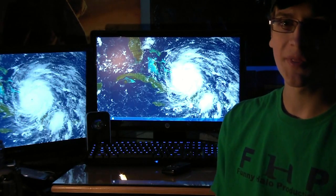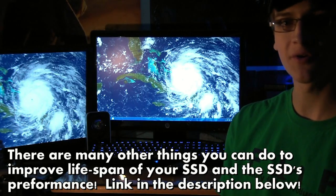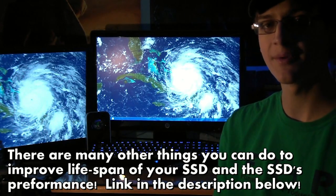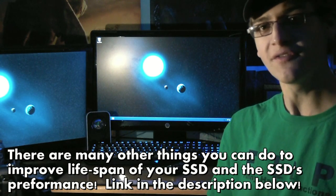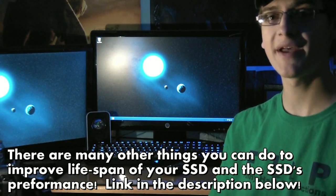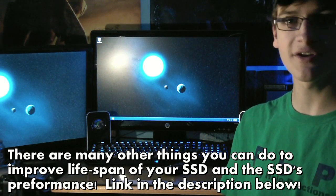The question becomes: is it worth it? If you ever change your mind, you can always boot from your old hard drive again, as long as you don't delete the OS — just go back into the BIOS and change the boot order to boot off the hard drive instead. I hope this helped you out when it comes to upgrading to a solid state drive. If you have any questions, leave a comment and I'll try to respond. I'm new to this as well, so I'm not totally versed in the topic, but I'll try to do what I can. Thanks for watching — if you liked this video, please feel free to subscribe and check out my other reviews and tutorials.